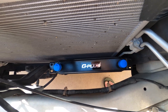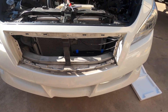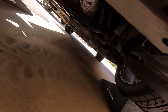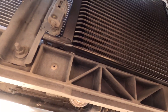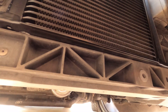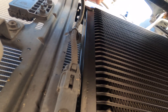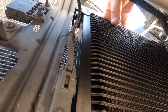With the grill off, I have much more room to reach in and fiddle around. Coming down underneath the car, we can actually see the cooler sitting right there — there's a nice little shelf that Infiniti provides, and we can probably get some self-tappers into the bottom. Up at the top, we'll probably make some sort of L-bracket to bolt to this upright support to make the mounting more stable.